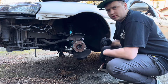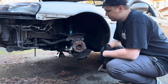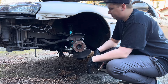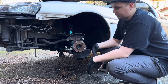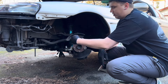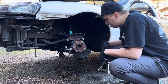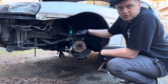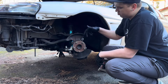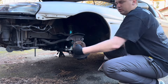Now you'll see here that we have this ghetto-cut dust shield for the brakes. When I was first doing it, I should have just cut the whole dust shield off, but I just had tin snips at the time and didn't have a grinder, so I ghetto-cut this just to make room for my angle kit. There are just a couple of little bolts on here — I'll let you guys know the size when I figure it out. I'm going to take those bolts off and then use a grinder to cut the sleeves off, bend it, and get it off.